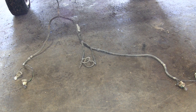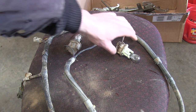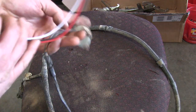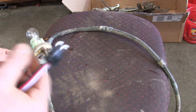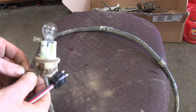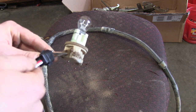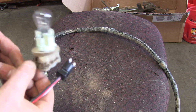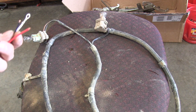The lights seem to work and I've got the right side the way it's supposed to be, so I know my right and left. The running lights are actually burned out but I think they'll still work. Now that I know my wiring is good, I'm going to cut off these lights and sockets so I can wire in my pigtails. I'll just twist them together and wrap with black tape temporarily to make sure they're going to work before I go ahead and drill a bunch of holes in that brand new plate.